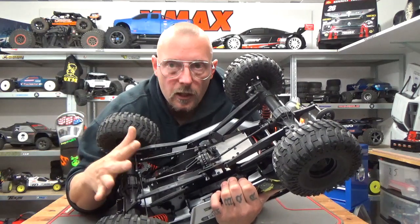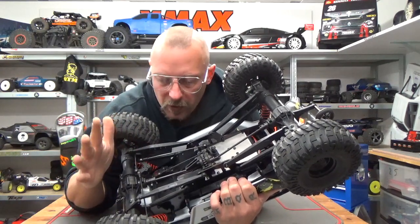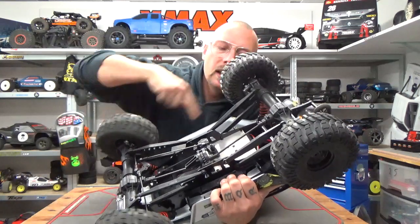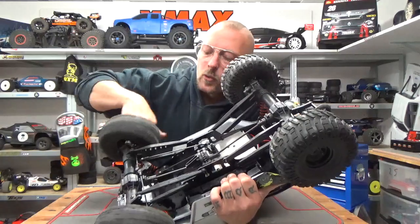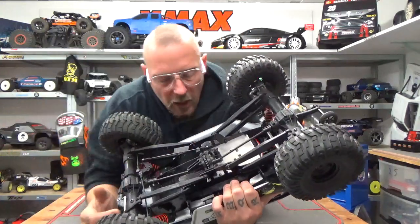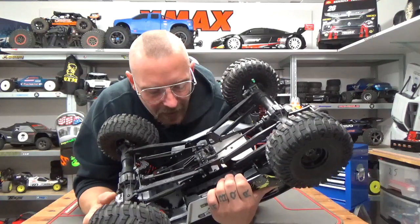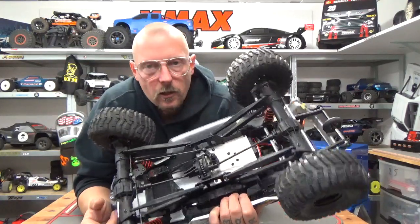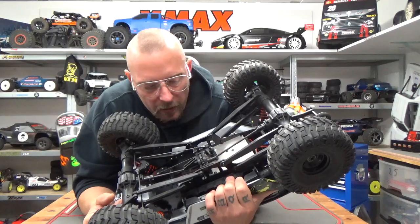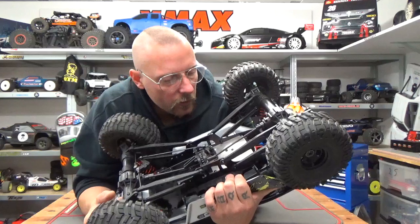The only thing I will change, I drive it stock, but I'm only going to change the oil in the suspension and also the oil in the axles, because this is way too soft for real off-road. The chain is awesome. I never had any issue in more than 3 years driving Kyosho Fo-Xxs. It never breaks, I have no wear on this chain, I really have no issue.